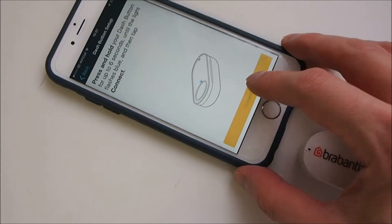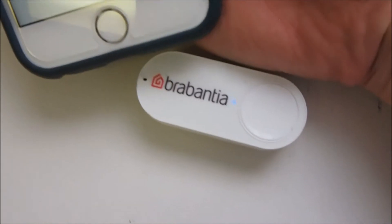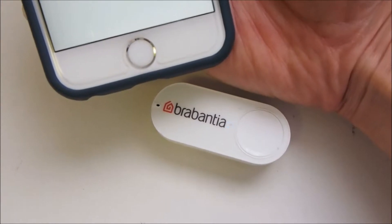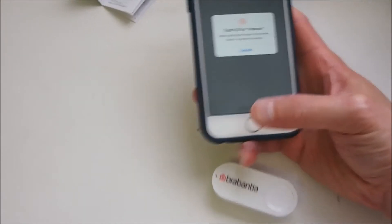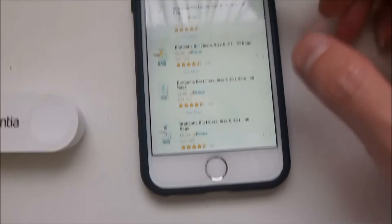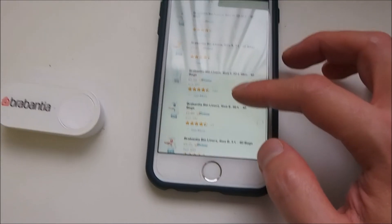Let's try again. I've now associated my iPhone with my 2.4GHz Wi-Fi access point instead of the 5GHz one, and I'll repeat the process. The blue light is already flashing because I held the button down earlier. And there we go — I saw the green tick on the phone, which is good. So the issue is confirmed: you can't use one of these with a 5GHz Wi-Fi network.